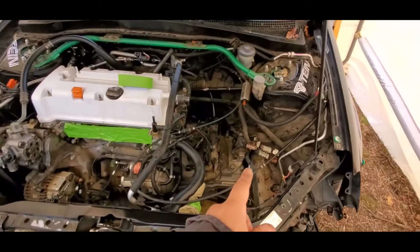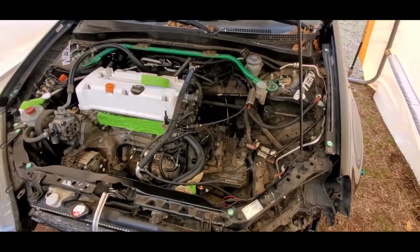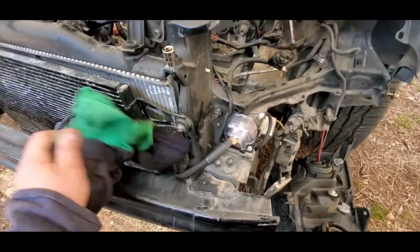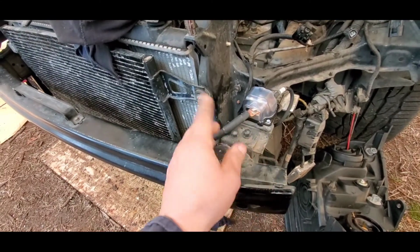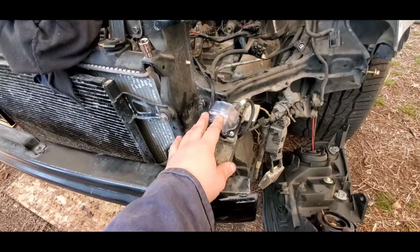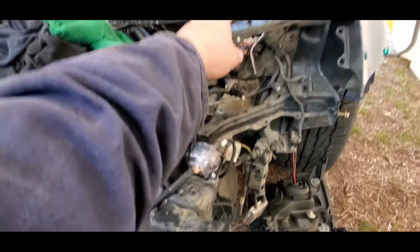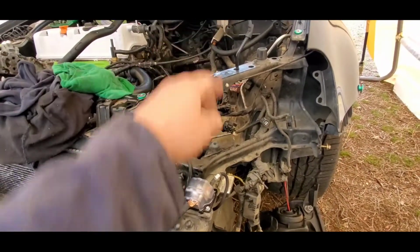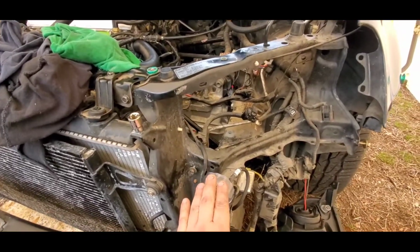Anyways, yeah, so I gotta pull that through and do all that stuff. Let's see what else I did. Okay, so I hooked up the wires for the relocation thing. I got two wires that got to go from here to the fuse box. I got Surge's kit. They were too short because they're for the stock location up here, so I'm gonna go ahead and extend these so they go all the way into the inside. So I'll be doing that, lubing all that stuff up.